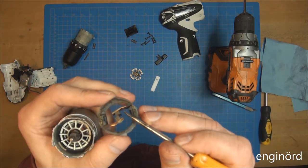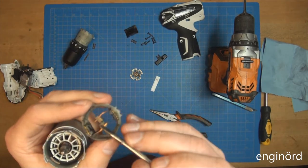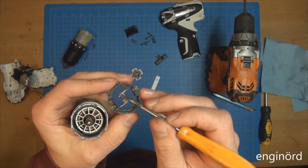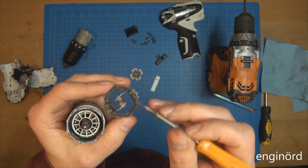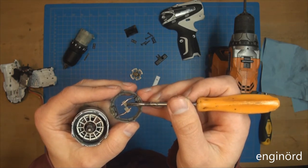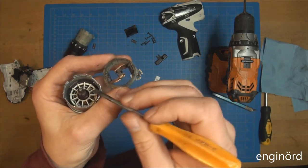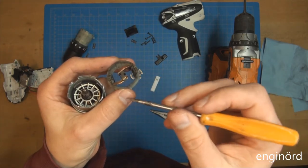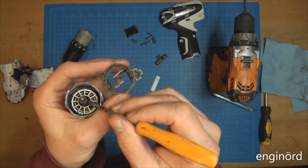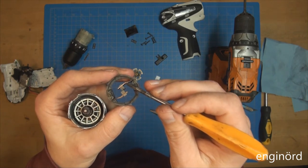there's a lot of physics in these parts. People don't realize how complex a system just this spring is. So we've got current flowing through this part, which is going to heat it up. We also have current flowing through the brushes, and then when the brush commutates with the commutator here, as the commutator spins, there's sparks and all that stuff, and that also heats up. We basically have plasma here. There's plasma. So everything is heating this piece up.